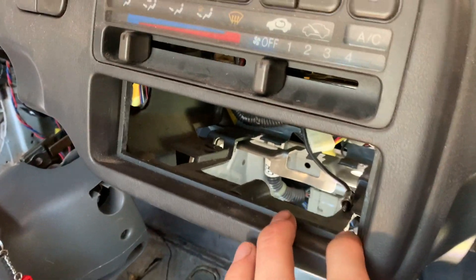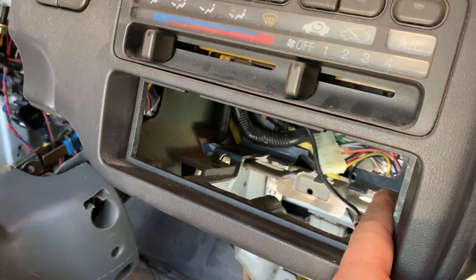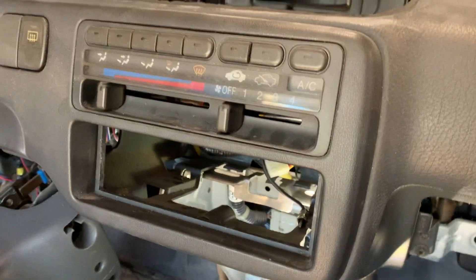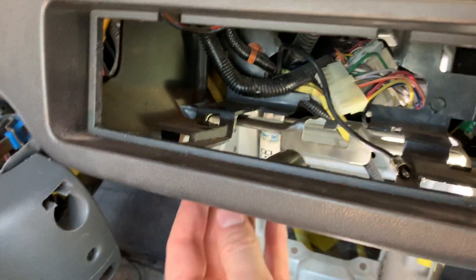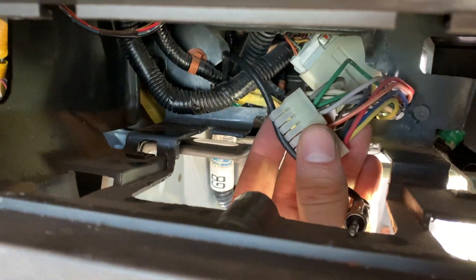So the radio is out. I'm not sure how you take out a stock radio, but for this radio I just had to slide a screwdriver in there and kind of pry the tabs loose so it'll pop out. Then I had to take that metal insert out. For the aftermarket radio I had to bend all the tabs out and pull it out. The radio just has two attachment points: the antenna and the radio harness connector.